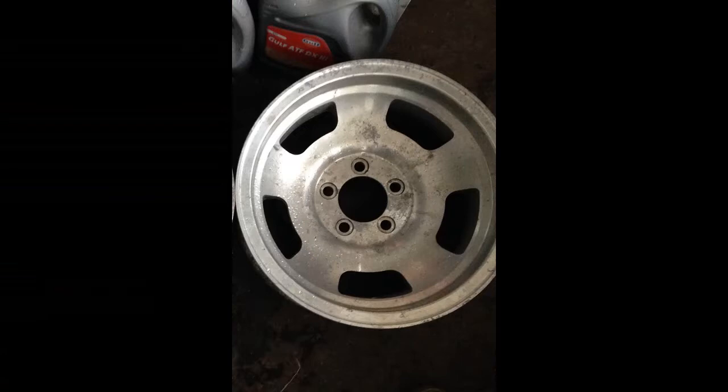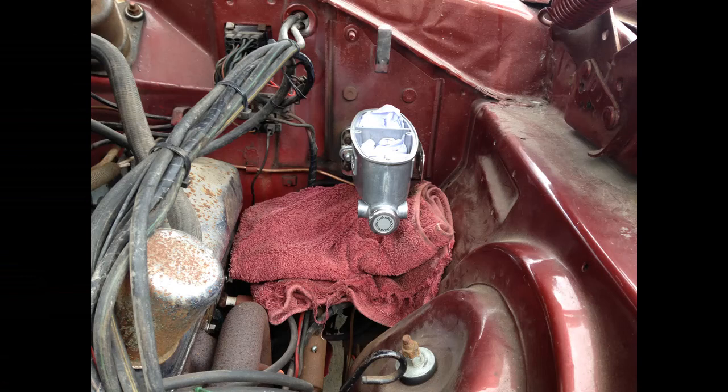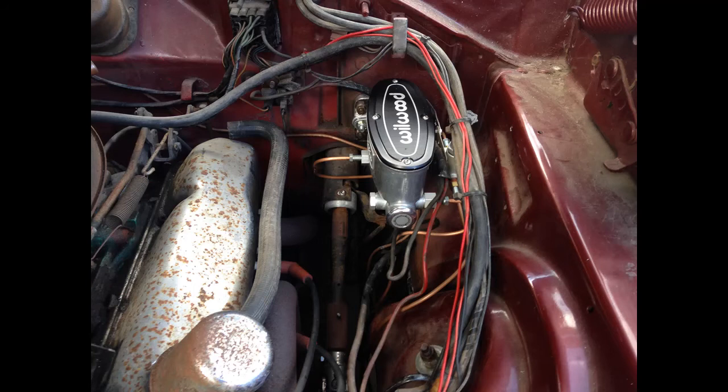So I did the right thing, went on the internet, found a new set of wheels with the right offset that would fit the caliper, and I bought those. This is the new one, and this is the original one on the left with the new one on the right, showing the difference in offset between the pair of them. I also got a Wilwood Master Cylinder as part of the kit, and a proportional valve visible on the right. The Master Cylinder was bench bled, and bled again through the pedal before I connected the brake lines to it.